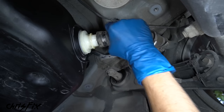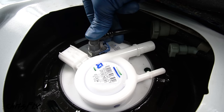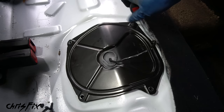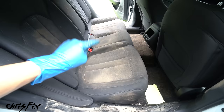With the tank bolted in, remove the jack stand. Now finish up under the car by putting the hose clamp back on the filler hose and sliding that hose onto the fuel inlet until it's fully seated all the way down the fitting. Snug up the hose clamp — don't make it super tight because it could crack the plastic fitting, just tight enough so it won't leak. Now connect the new fuel pump — get the main fuel line connected so it snaps in, then connect the other two fuel lines making sure they both click. Reconnect the wires by pushing the connector on all the way and pressing the red tab in to lock it. Get the cover in place, tighten down the four screws at the corners, and get the seat back in pressing down on each side so it snaps into place.